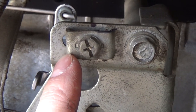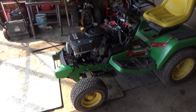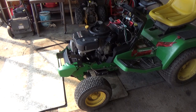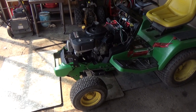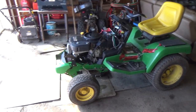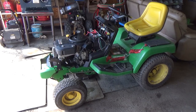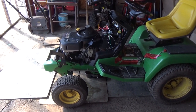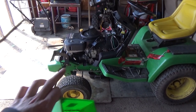Anything I'm removing that I can put back in and tighten up, I am doing that. Whenever you're doing an engine removal there are going to be a lot of bolts, and if you're not careful organizing them you can get confused about where a bolt should go. This is a great time to get yourself a magnetic tray — it allows you to keep all your bolts organized. You can also use Ziploc bags. Right now I'm going around disconnecting everything I need to, and then we'll tackle the engine bolts.